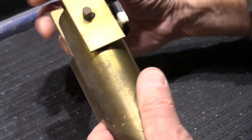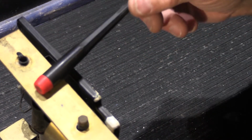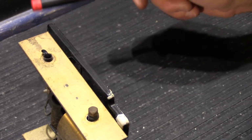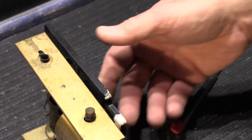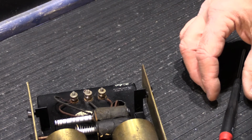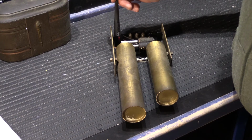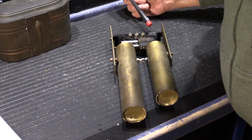If we turn it over on the side, we have tone bars on either side, and these tone bars have a brass finish. Now, whether they're actually brass or whether they're a steel tone bar with a brass finish, I'm not sure. I would bet on a steel tone bar with a brass finish, because one of the things you'll notice that's different about this chime is how the tone bars and the resonators are assembled. On this model, the tone bars are still held onto the base assembly on the metal standoffs, and they're the remains of what grommets there were.